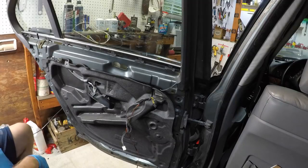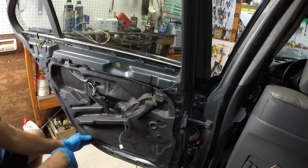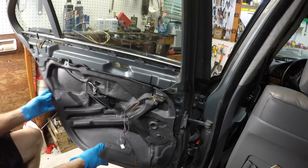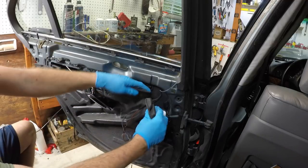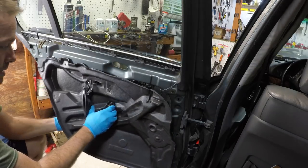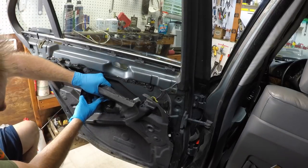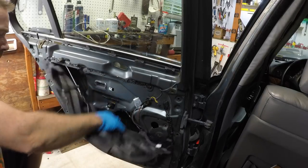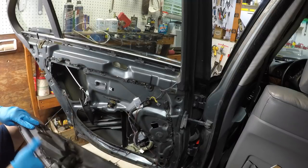We've got the camera plugged in because the battery is almost dead. Here is the door foam - somebody glued it on the bottom but it wasn't glued good enough, and the sides are open. We're going to want to remove all this and reseal it. This is the main cause of water leaking into the back floor if that's not sealed correctly.